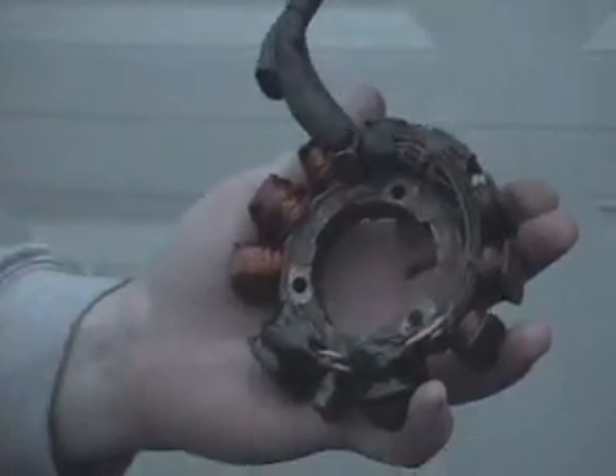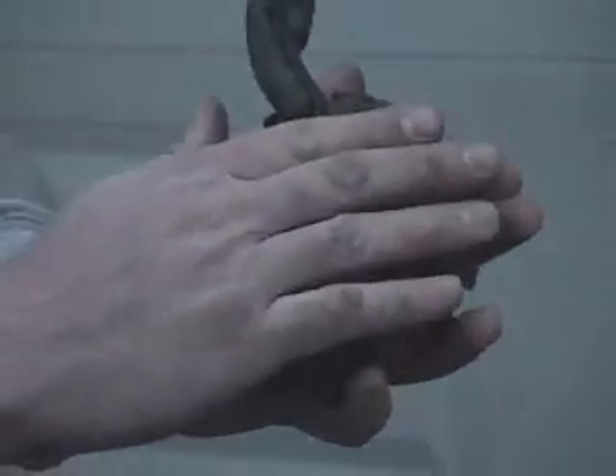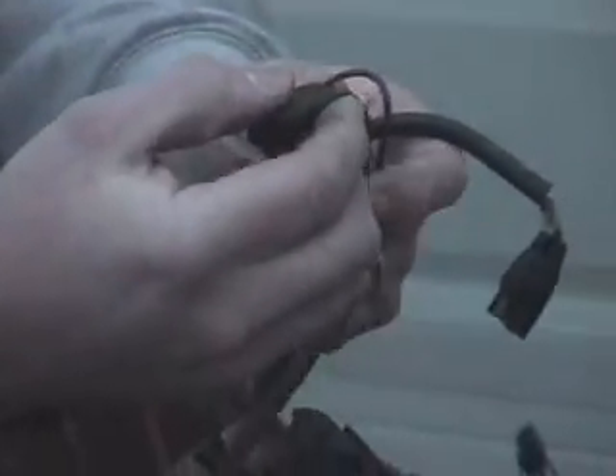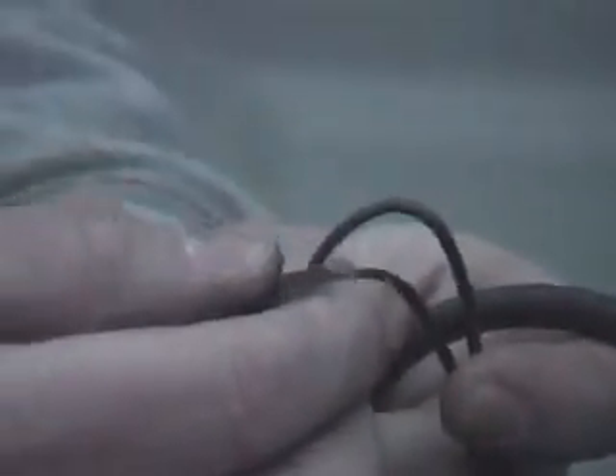This is like an early-90s EFI battery stator, so all of these coils would be used basically to charge the battery. It's got three yellow wires coming out of it — it's one of the only ones with three yellow wires coming out that plugs into your wiring harness. Most of the other Cats just have two yellow wires, so I'll show you some more of those.